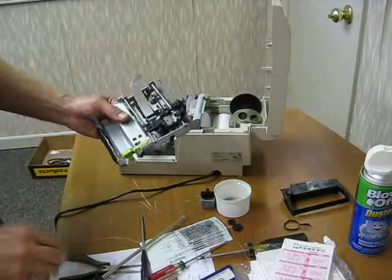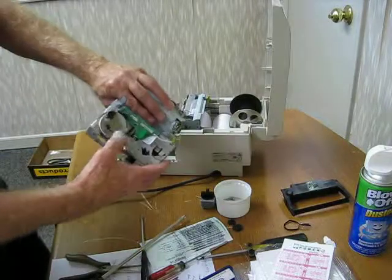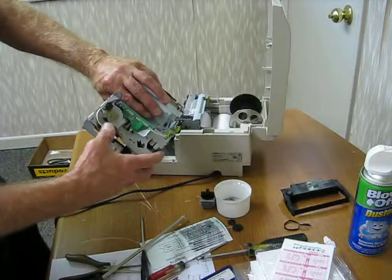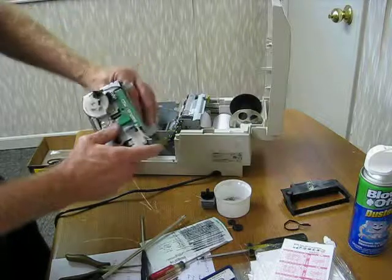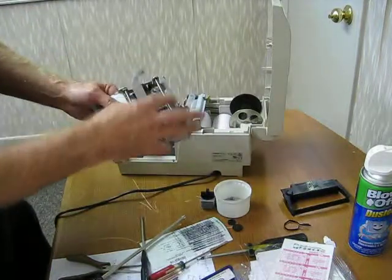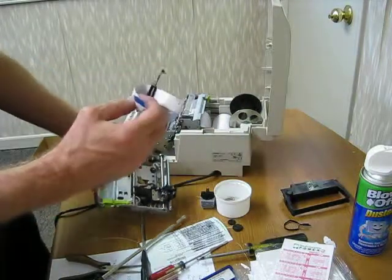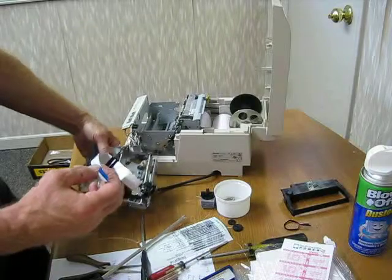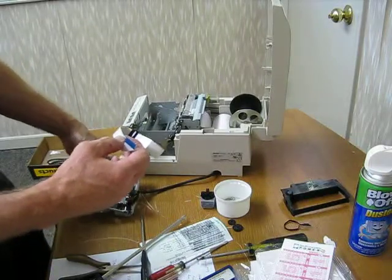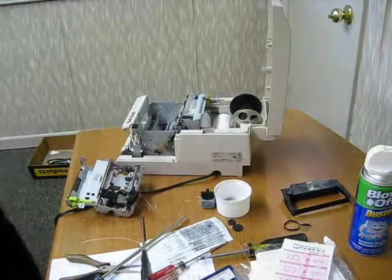Okay, ribbon cable. You saw in the previous video how we loosened the encoder, the motor and the encoder wheel. Got the green board freed up enough where I could take the gears off and the print head off, and now I got to get this little black thing out of the way. This is holding the ribbon. Basically, you want to lay things in a position where you don't mess something up in the process. Just keep an eye on that while I get us apart.